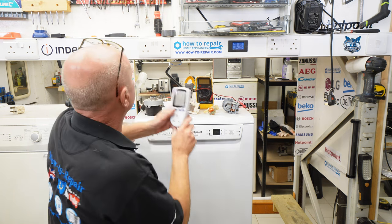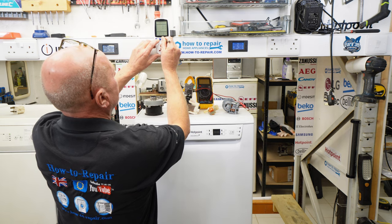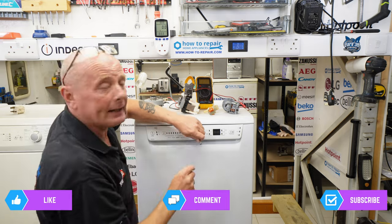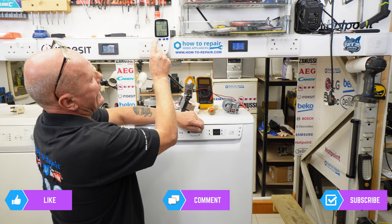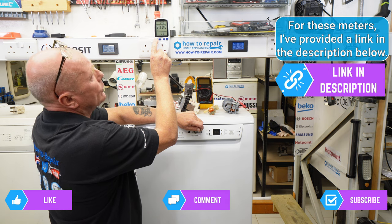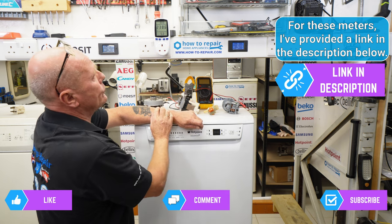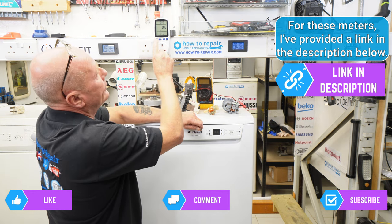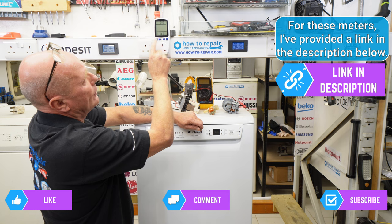Let me explain how to use this meter. First I'm going to plug the meter in and reset it by pressing the reset button — it's all set up correctly. You'll notice the time is at zero. The functionalities we have are the wattage, the kilowatt hours used during the whole time until you reset again, the voltage — because it's connected we have 238.6 volts — and 50 hertz frequency. The next button tells me the amperage the appliance will be drawing, and the last button gives me the low and high wattage usage.